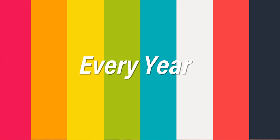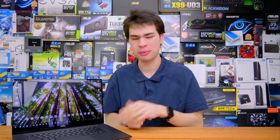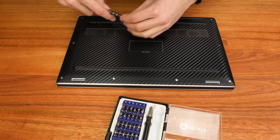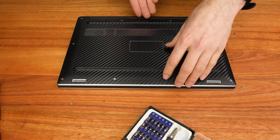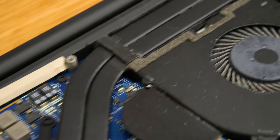Finally, every year there are three things to keep your system running its best. First is a little more technical: open up the system and blow out any dust. Making sure dust is no longer in the heat sinks and inside the system is crucial. Try not to use brushes or vacuums — use compressed air or cans of compressed air to get dust out. Dust acts as an insulator, trapping heat inside your system, causing it to run hot, fans to kick up, and potentially making it run slower. Keeping it clean is one of the best options.